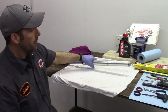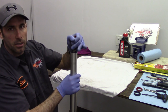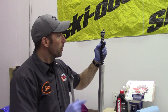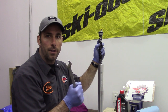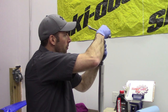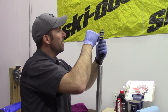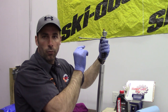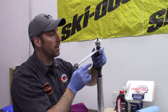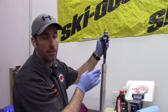With the fork off and resting on the bench, we're going to take the top cap and completely loosen it. That's going to allow our outer tube to simply drop down and slide out of place. On this particular fork, we've got a four-sided nut — on this one it's 19mm. Just by hand, we're going to compress the spring down a little bit and grab hold of that nut. It's got a slight ridge on the top of two of the sides, which is going to hold our 19mm wrench in place. So you don't need a specific holder tool to keep that spring away.